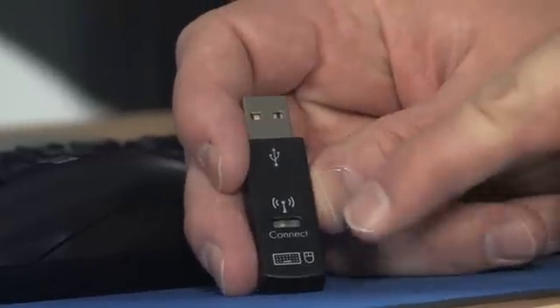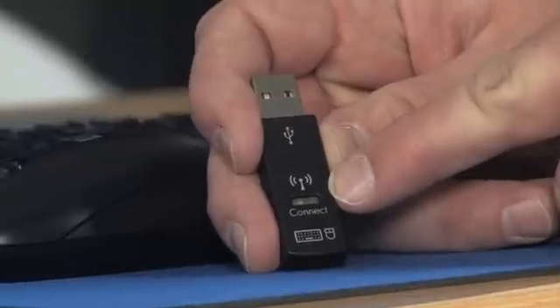When you talk about synchronization with the keyboard, mouse, and receiver, you basically have three devices that need to talk together. During startup, the receiver tells the BIOS that it's there and the keyboard is active, so you can press a key and go into BIOS. The receiver looks like a USB thumb drive — it has a connect button on it. This tells the computer or BIOS — Basic Input Output System — what the device actually is. There's circuitry on the receiver that tells the system what it is.